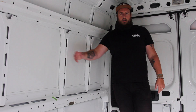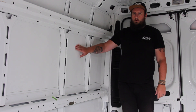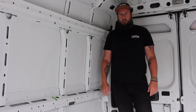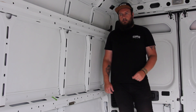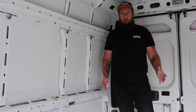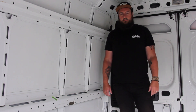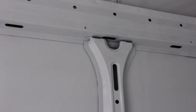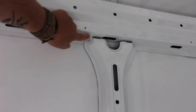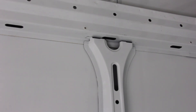If we take these ribs out it allows us to put a frame in where the mattress will sit, back all the way to the far wall. We'll put some insulation on — probably not as much as the 25mm we're going around the van, maybe closed-cell foam — just to allow us maximum space, which I'm hoping will be about 195cm. So plenty of space to stretch out with a double mattress. The way we're going to remove these ribs is there are two spot welds right at the top, and then the same on the bottom, so I'm going to start drilling those out.